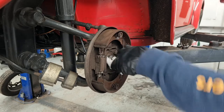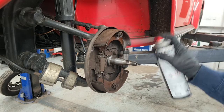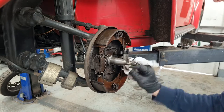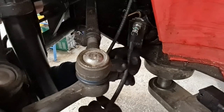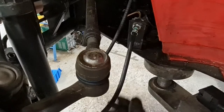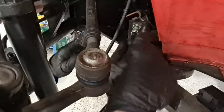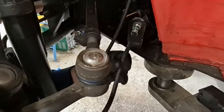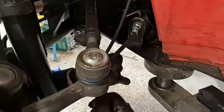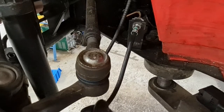I'm going to clean down with some brake cleaner — I've got a catch tray underneath. We can now check our flexible brake hose for condition, make sure it's not perished and sits naturally, and that we haven't got any leaks around the connection on the hard pipe. We can also check the manufacturing date printed on these rubber hoses — the date on this one is 2022, so we know our brake hoses are good for another six or seven years yet.